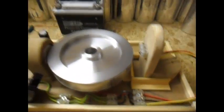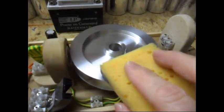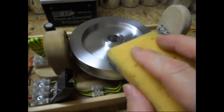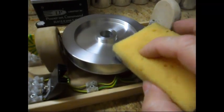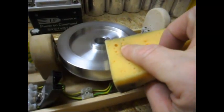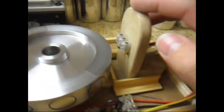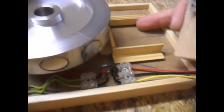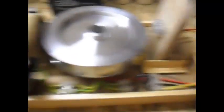It is disconnected. Because of the momentum of the rotor, it will keep spinning for a while of course. You can see the whole base is sliding away a little bit. Let me stop it — otherwise it will keep spinning for a very long time. As you can see, the whole sensor has been put in the same place where the trigger coil was. I didn't need to adjust it — not one bit. It fits snugly in place and it works just fine.